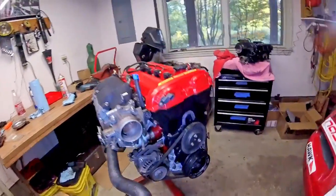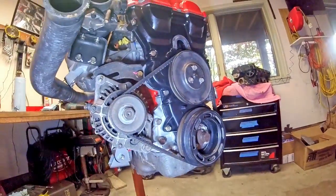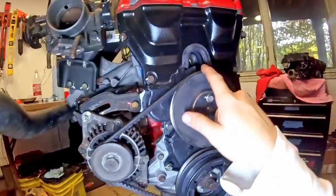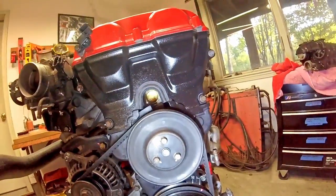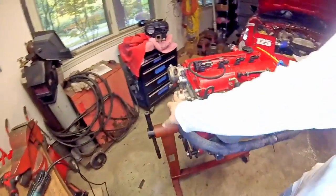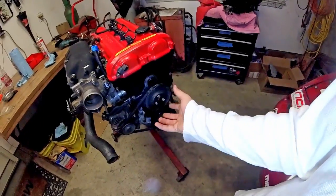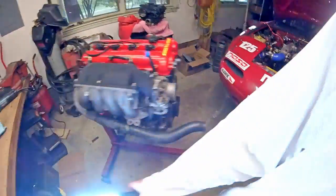I got the entire 1.5 Mazda Protege plastic covers for $35 and they fit perfect. I'm reusing the 1.8 upper cover because it has that hole for the water neck. I've plugged my front water neck head with a 30mm plug, but because I have that coolant reroute on the back of the head, all that water comes up front into the radiator. Normally the front water neck holds your water temp sensor which triggers your fan kick-on, but I'm on a MegaSquirt so that part is unnecessary.